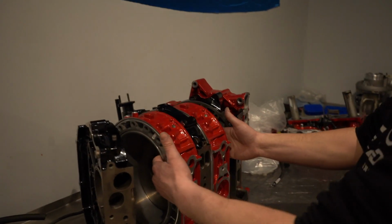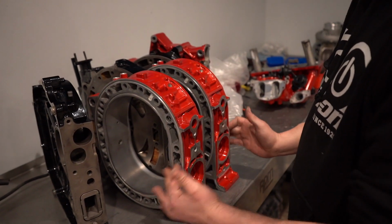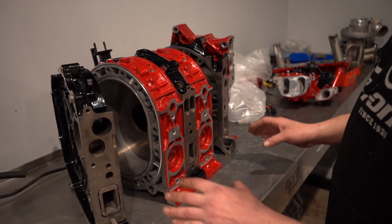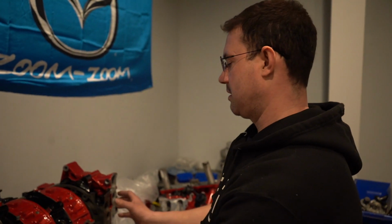Now, the next step we will be swapping the rotor housings out for REWs and CNCing the water jackets into them. We will be doing one motor with all the ports, so that will be 6 ports. Then we'll do the same setup with the header, where we'll have a short version and then use the long version. The long version will have V-bands or slip joints in it, so we can adapt the hybrid to the Renesis header very easily. Cheaper and less time consuming.